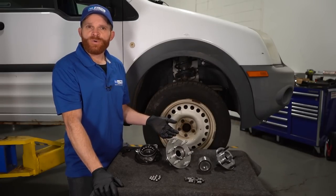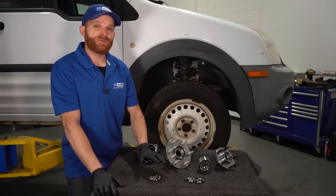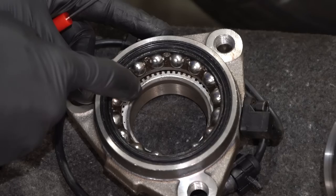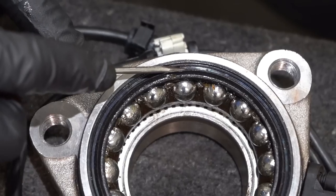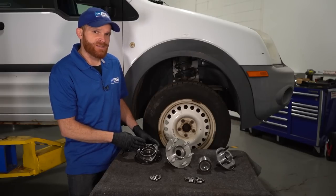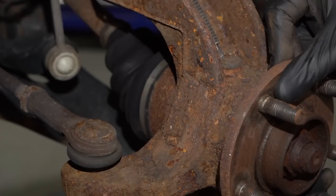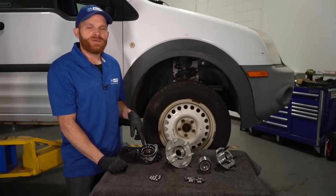On your vehicle, depending on what type of bearing you're going to have, inside of it you'll either have ball bearings, like these right here, or roller bearings. Ball bearings are the most common to have in the front. If you were to look inside this area, which is essentially the bearing side of a sealed wheel bearing, you're going to find a whole bunch of those little ball bearings making their way around. They're supposed to be lubricated by grease. What can potentially happen is if the seal was to go bad for any reason, moisture could potentially make its way inside. If moisture made its way in, it could potentially make them start to rust up inside. When it starts to rust, the metal is going to get weak and start to wear down, causing noise and a little bit of movement from the wheel bearing. If the bearings heat up due to a lack of lubricant inside, it could potentially cause some wear as well.